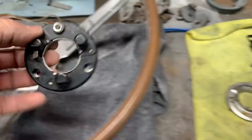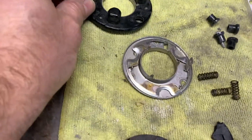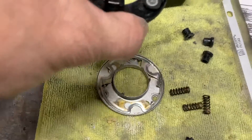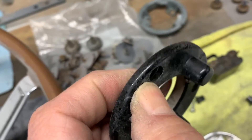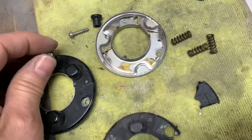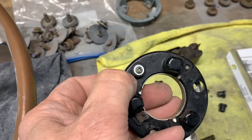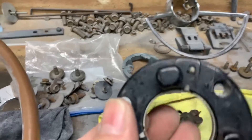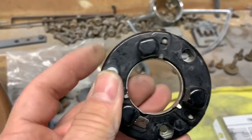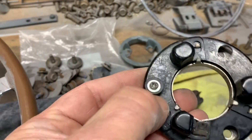One other thing to check when reassembling all of this back into your steering wheel assembly: you have these three standoffs that allow the horn button to be mounted directly up against the steering wheel while allowing the outer ring to move on the springs to make its inside contact. When you're reassembling this, make sure that once it's bolted down, this moves freely and it's not binding on these standoffs. If it is, loosen up all three, give it a little wiggle, and snug them back down. You might even want to put a little bit of white lithium spray grease or something like that to keep it lubricated so it's moving right.